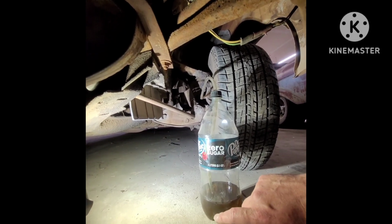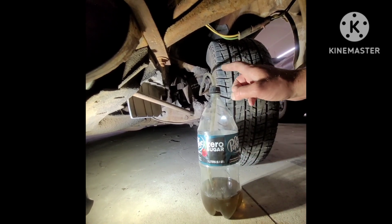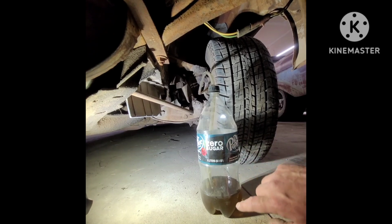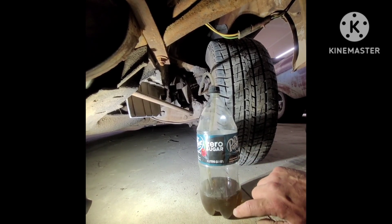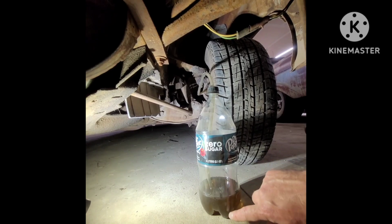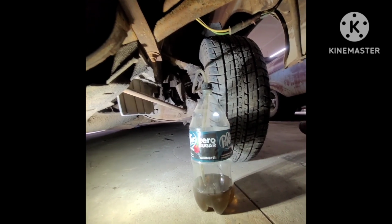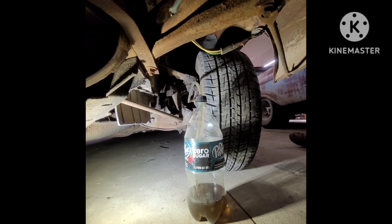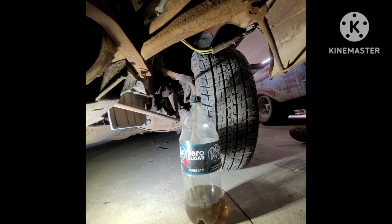So all I gotta do now is push the brake slowly. It'll pump the fluid through, all the air bubbles will come out, but then when it suctions, it's only suctioning on the fluid, therefore creating a zero air environment. It's hard because I don't have visual on this, so sometimes I use a broomstick.